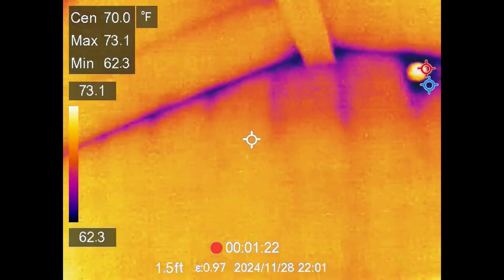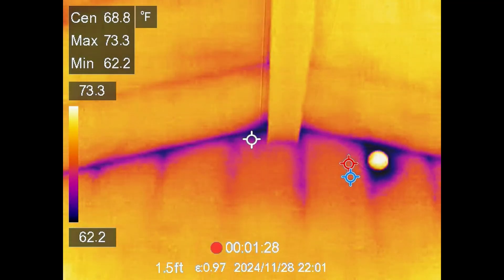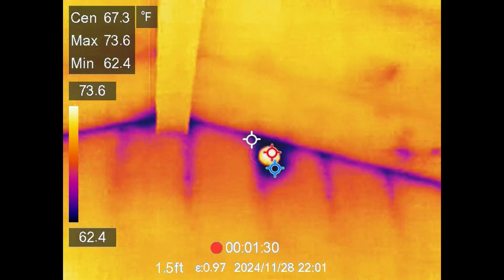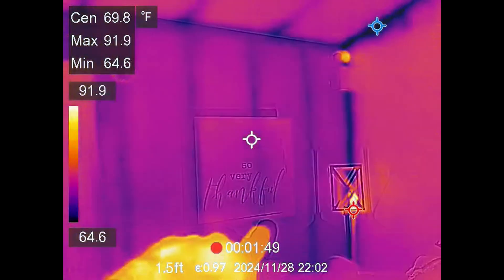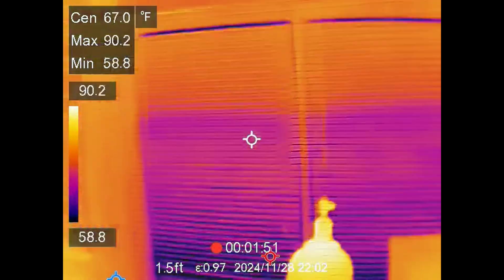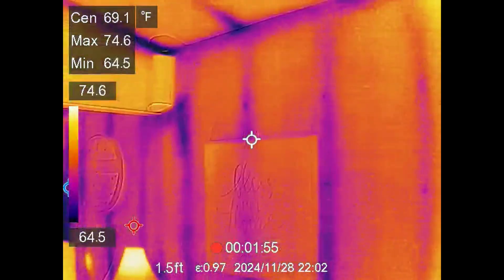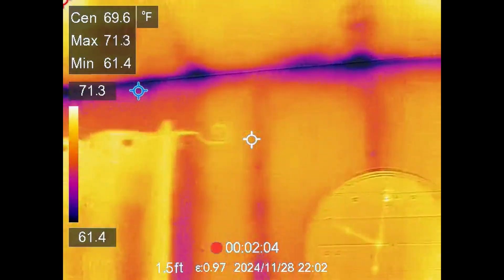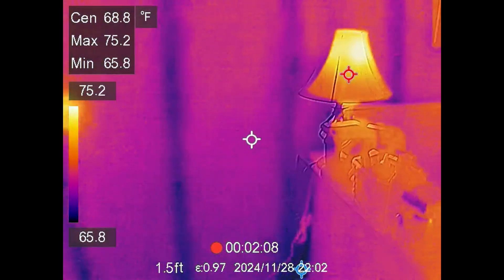On the cathedral ceiling you can see there's a little bit of insulation loss up at the top. It's 30 degrees outside — you can see the smoke detector right there and what looks like a little gap around it. The wall 2x4s on the side are pretty obvious. It's really that sensitive, picking it up through this picture. Anytime you have a 2x4 it's a temperature conductor and it transfers right through to the drywall.